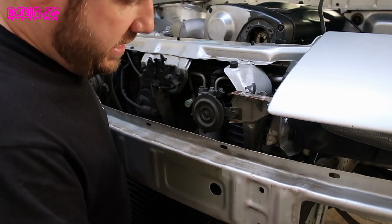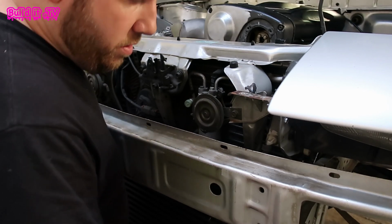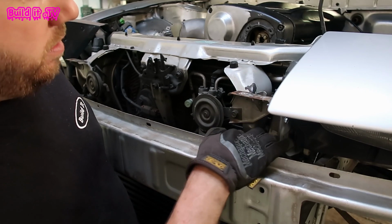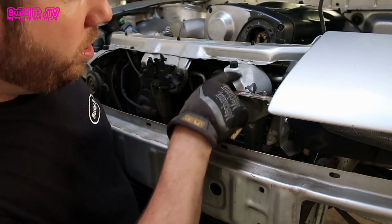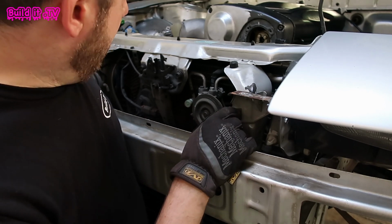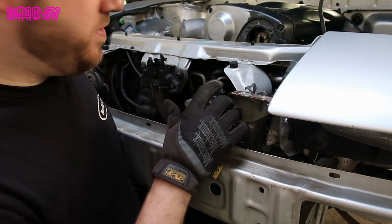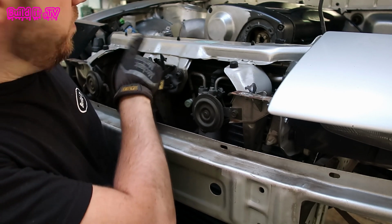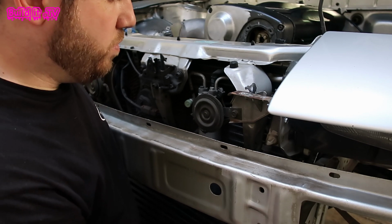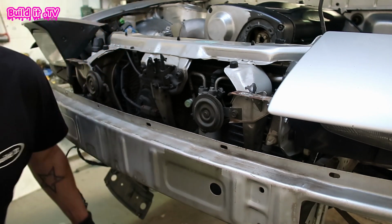So the next issue I found is with that core support cut out, the next bit we hit on are these brackets here. So they do actually just unbolt. I'll unbolt them out. We want to keep the bracketry for the front bumper. We still need to have somewhere to put the horns, and this stabilizes the front as well. So we'll need something in there to replace. Also, don't want to remove the bonnet latch. We want to keep that OE. So we're going to need to do something with the bits here as well. But we'll start by taking out these 2 side supports.